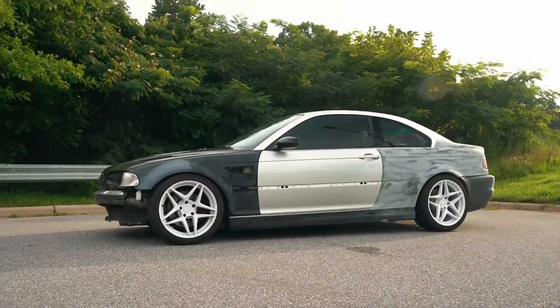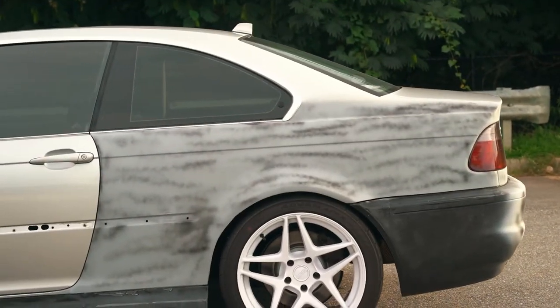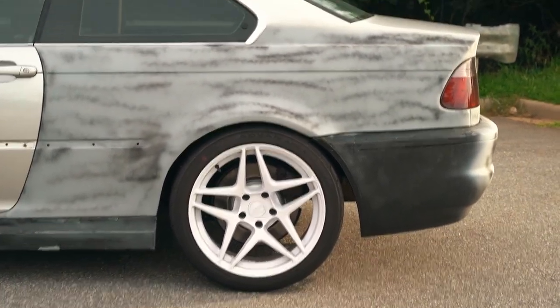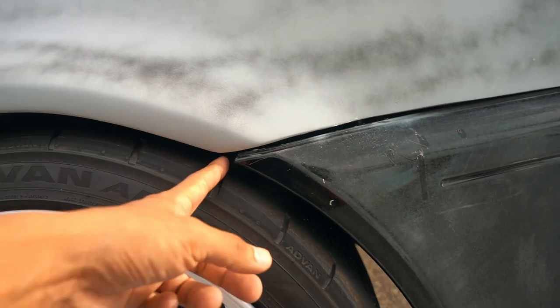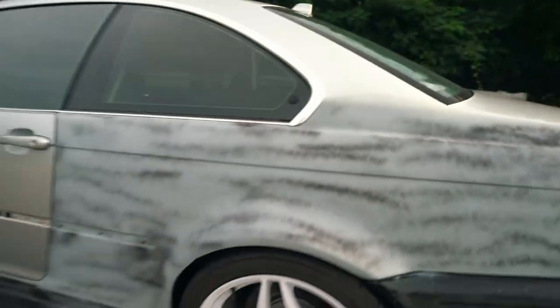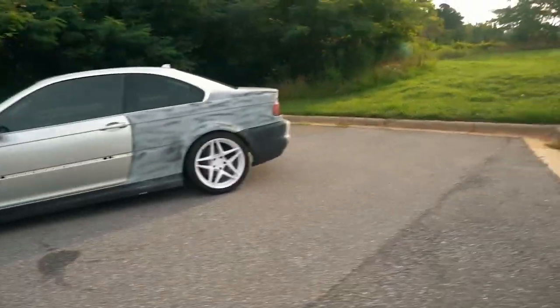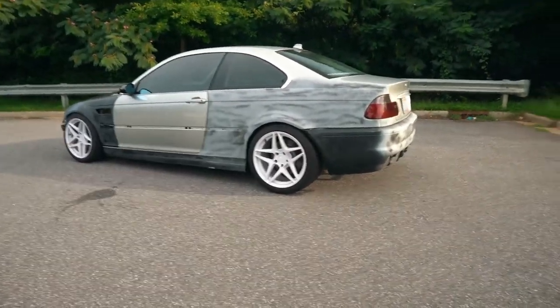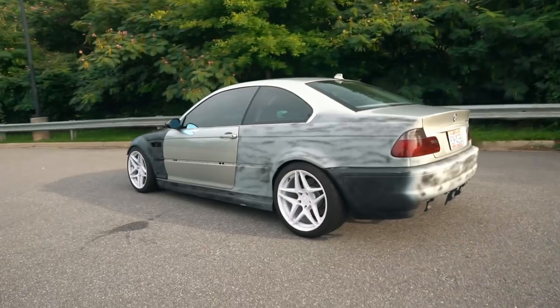Here we have the E46 at its final ride height — I think. The front looks good, but when we come around to the back I had to raise it up because it was rubbing. Now I've got a slightly bigger gap in the back. If I lower it anymore, this piece tends to rub on the bumper still, even at certain dips. I might drop it just a hair since it's easy to adjust, but I think that might be the height it has to stay at. I was going to take it for an alignment, but I'm still not satisfied — there's more tweaking to do.